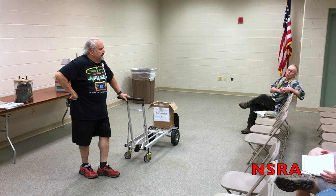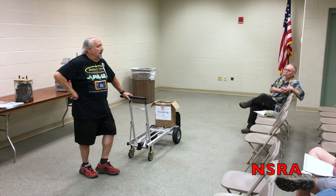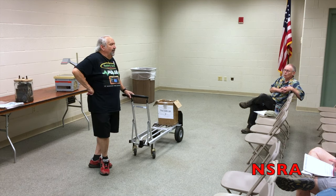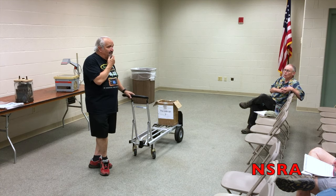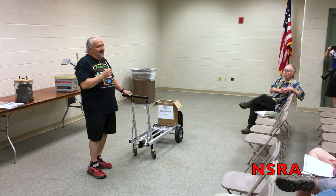How does your unit exercise the battery? It draws current and charges both ways. Yeah. It discharges and recharges, and it puts out an ultrasonic pulse. The ultrasonic pulse repels the sulfur from the walls of the plates. In fact, how we do it is we reverse the polarity, which you would normally not be able to do.